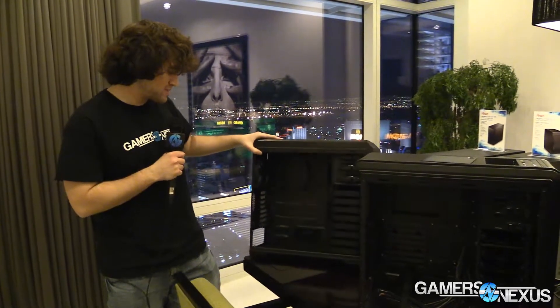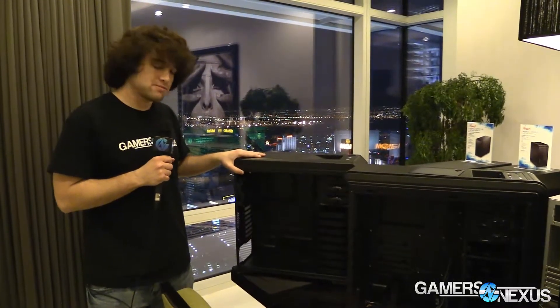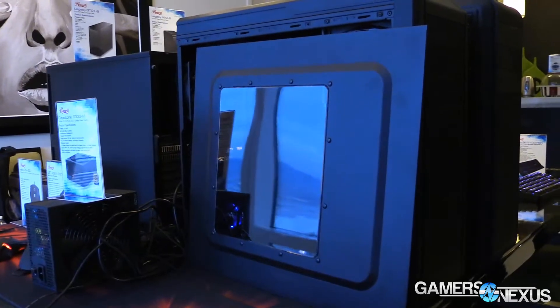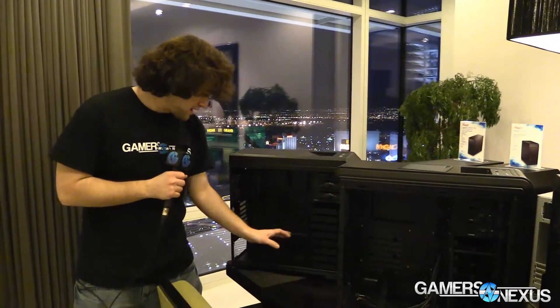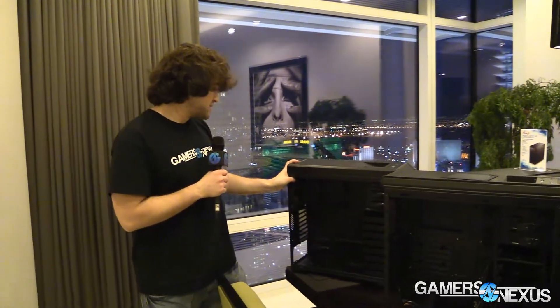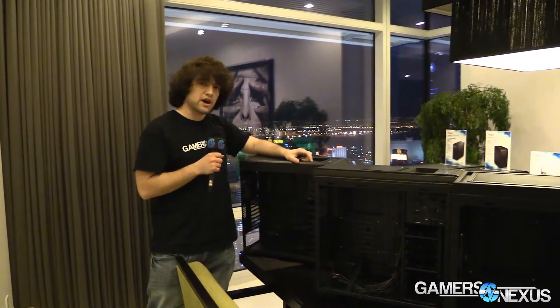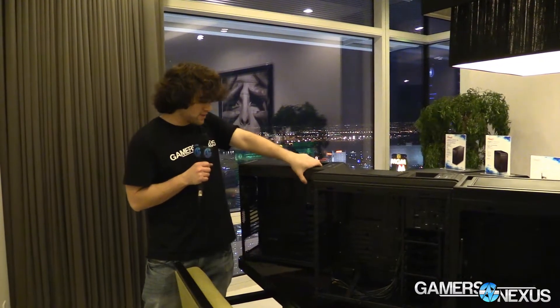Finally we have the Stealth case, priced at $70. It's a pretty standard low-end budget range case — actually reminds us a lot of the R5, which we liked a lot. Check the link in the description for that. Fan spec: all 120s, two in the front, one in the rear, one at the top, with plenty of spots to add more. No fancy fan hub, no fancy trays on the back since it is a cheaper case. We do have half an inch of cable management space in the rear, which is enough for a basic budget build. There are two simple fan controllers up top with a high and low setting on each, giving you two channels to set front and rear fans at different speeds.